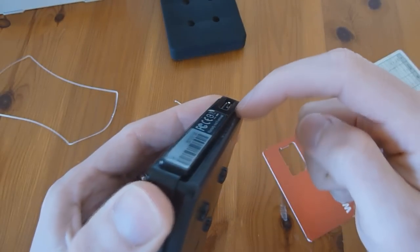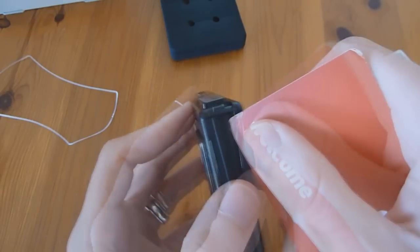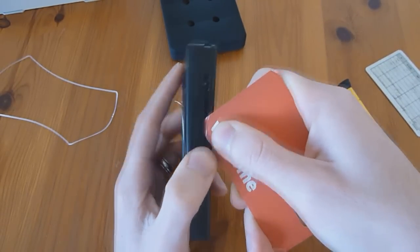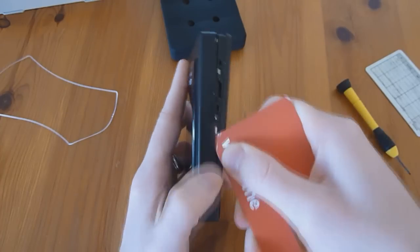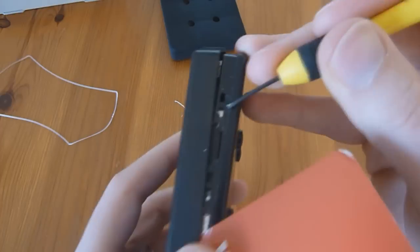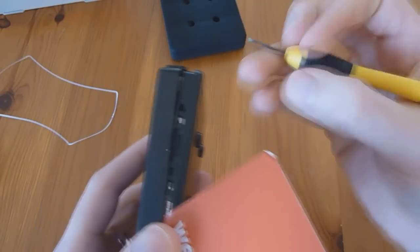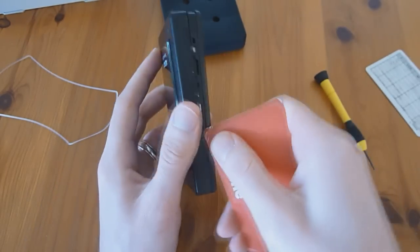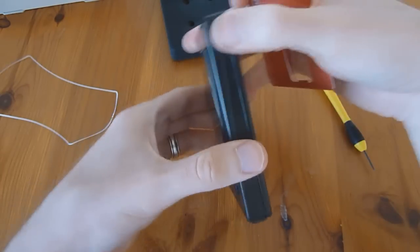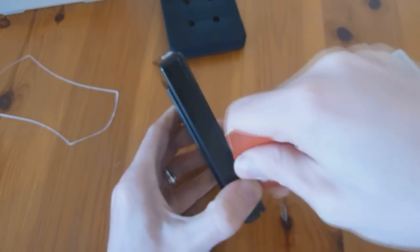That way the top clips are undone, which makes the next part a lot easier. Take the edge of the credit card and stick it in between the two parts of the chassis and just work your way down. It can be a bit difficult but you'll hear the snaps all the way down. It might help to wiggle it up and down as you go, just to release the clips. The clips are on this side and they fit into these little holes. Try to push this part of the chassis down away from the top part. Keep going down, wiggling up and down, until you get to the bottom. Then take it out, go to the other side and do the same. I've done this three or four times now and haven't broken any of the snaps yet.